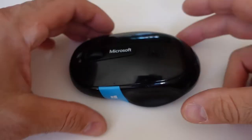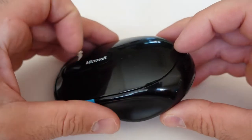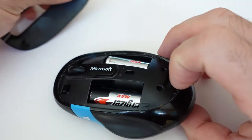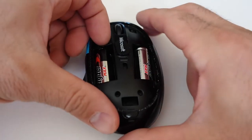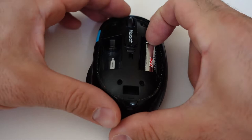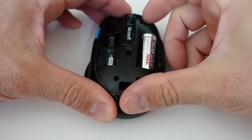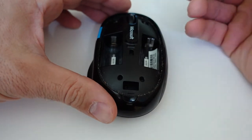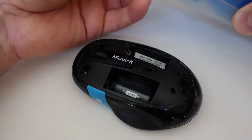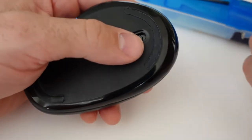In this video I'm going to disassemble and repair this Microsoft mouse. The problem I have is with the scroll wheel — sometimes it doesn't work at all, and sometimes you scroll down but it bounces back up like it's receiving bad input. I've already checked the drivers, tried re-downloading them, restarted Windows, changed the batteries, and checked the scroll speed in Windows.